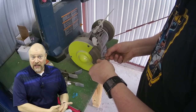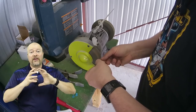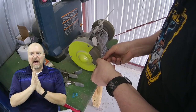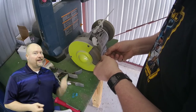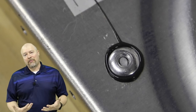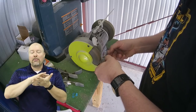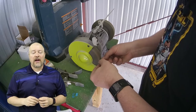On the previous tank, what I had done was use a bolt — I screwed it in, put some Loctite on it, cranked it down, put pro seal over the top, and it should be good to go. This time, instead of a bolt, I used a pop rivet. Same thing: I put some ProSeal around the outside, put the pop rivet in, and then I'm going to ProSeal all over the top of it once that lower bit of ProSeal dries a little.